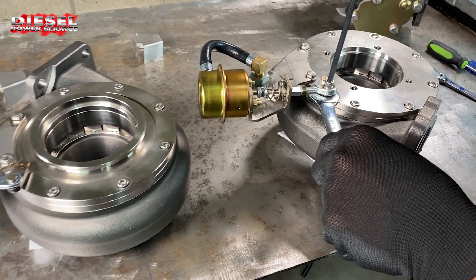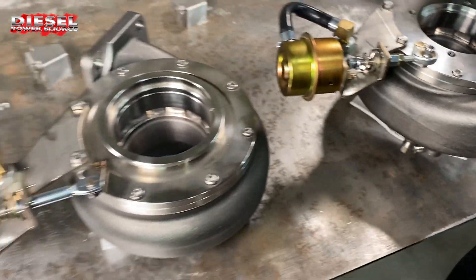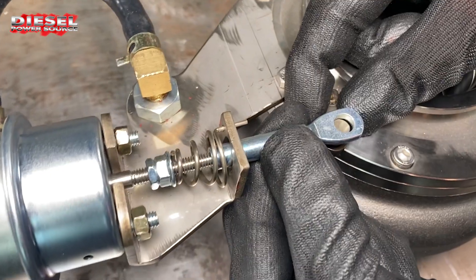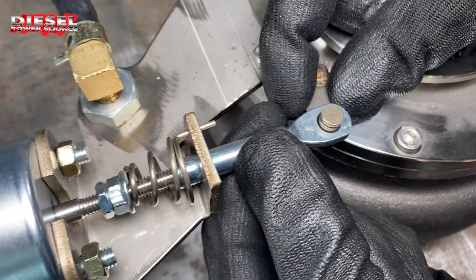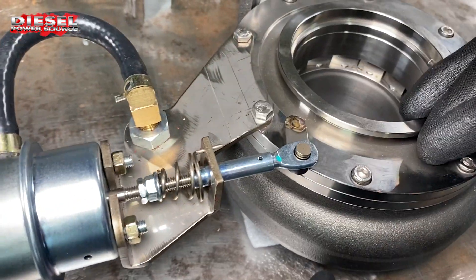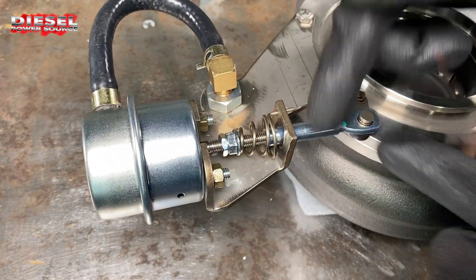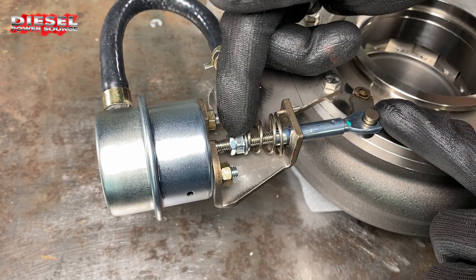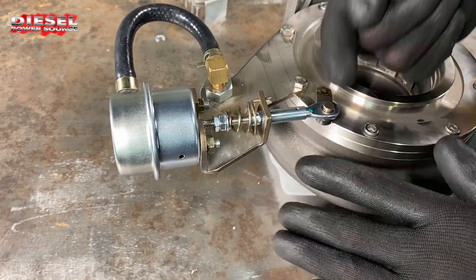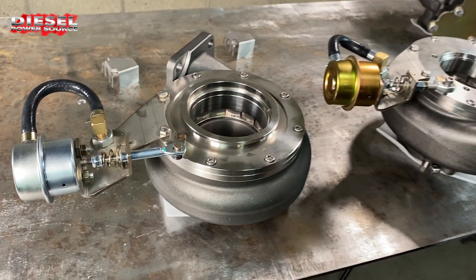On the pin style it's the exact same movement. The initial calibration is four and a half turns out. If you want to adjust it shorter, put it here and take the truck for a ride. You can also adjust by turning the jam nuts together — it acts like a turnbuckle. It's simply a matter of finding the sweet spot, going shorter or longer until performance improves.